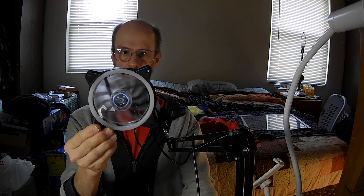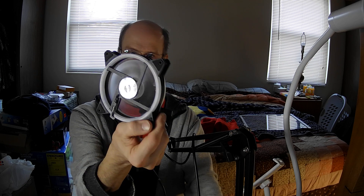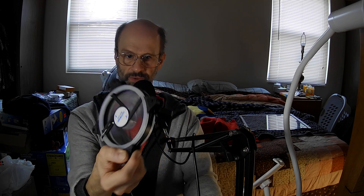There's something weird going on with this fan because when I plug this in to the fan controller, we're going to have a little bit of a problem. The lights are barely going to turn on. In fact, I can hardly see any of them on. I can see some green and blue lights on. So there's something weird about it. But if I plug it into the power supply with the Molex-D, it's fine.